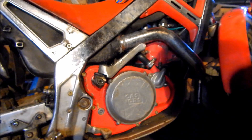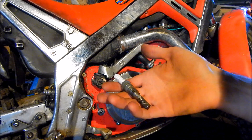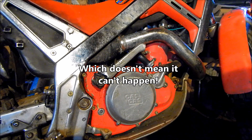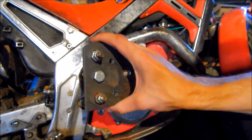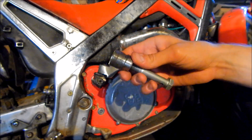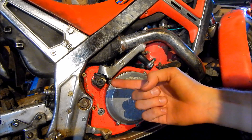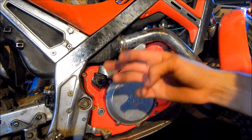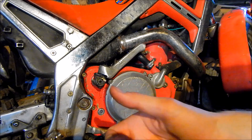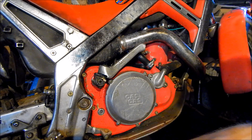Yes, it works now! I used a homemade tool that some of you don't like — it worked and the motorcycle still works, no damage to the piston. To pull off the flywheel I also used a proper puller tool — if you can get your hands on one, it's way better. I changed out one of the coils in the ignition, the spark plug coil, the spark plug wire, the rectifier, redid some wiring, and removed the faulty dead man's switch. So yeah, now it works.